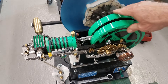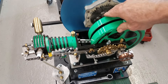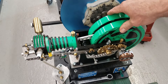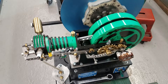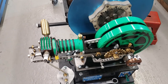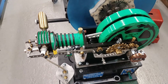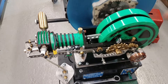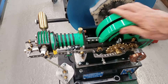Intake, compression, ignition, and exhaust — that's the four cycles of a four-cycle engine. A hit-and-miss engine is a four-cycle engine. It just regulates the RPM differently than a car engine. A car engine has four cycles, like any truck engine and so forth.